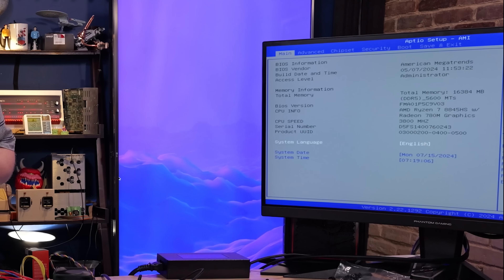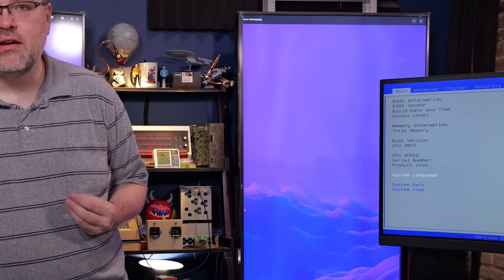We've got our 8845 HS with the Radeon 780M graphics. The Radeon 780M — we can actually leverage those hardware encoder/decoders in Linux. They're not quite as well supported as QuickSync, but the amount of progress made on the software side the last couple of years is really incredible. It is possible to use those for hardware acceleration with things like Plex Media Server and Jellyfin, though you do have a couple of hoops to jump through. They also work really well with OBS, Open Broadcaster.